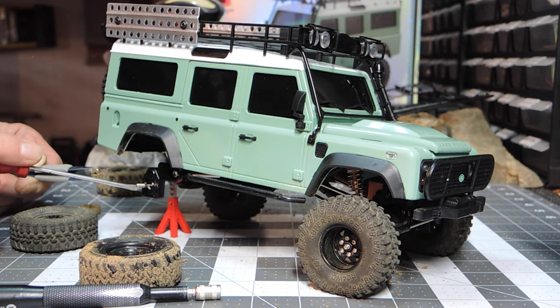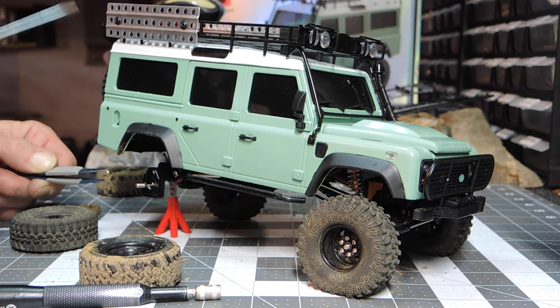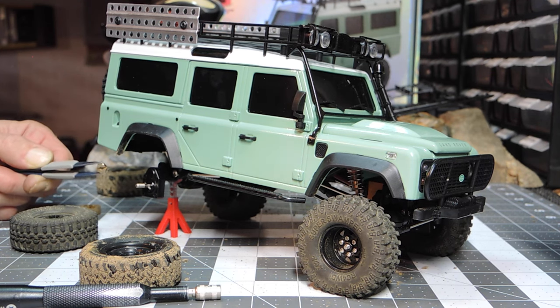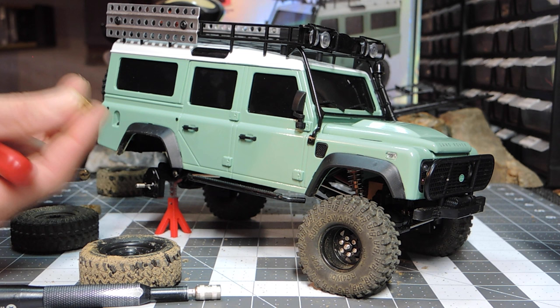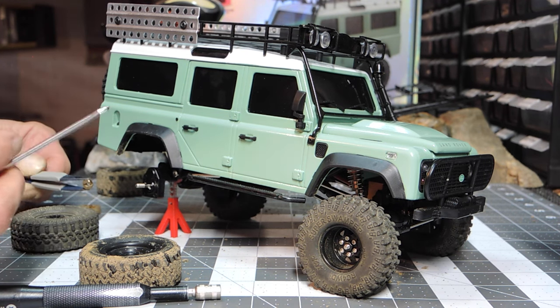However, on this, and I've been trying to rack my brain and figure out what the deal is, on these newly redesigned axles from MN, which are awesome, there's no doubt about it, the bearing is not exposed. This is plastic housing on the exterior, so anything that I was trying to put directly in contact with that, like a 10mm offset hub or anything along those lines, was causing binding as soon as you tighten everything down.